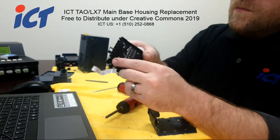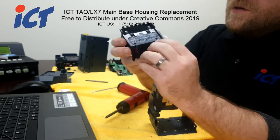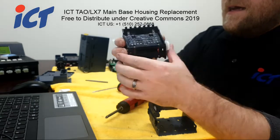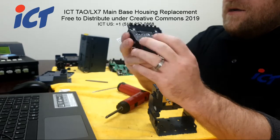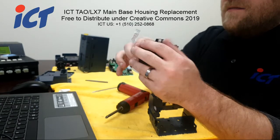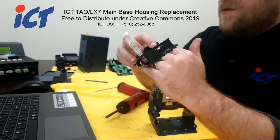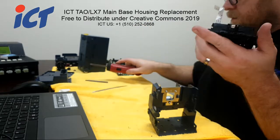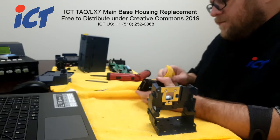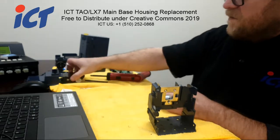Before you do, I generally check this bill path to be sure that there's no gouges or anything that might obstruct the bill as it's being inserted. Since you have it out, that's a good time to check, as when it is installed in a unit, it's kind of more difficult to see the upper housing. Let's set that off to the side for now as well.